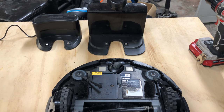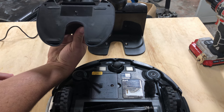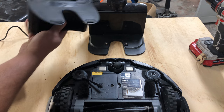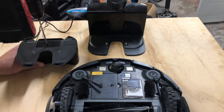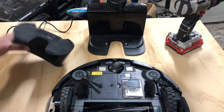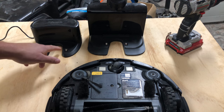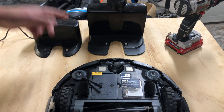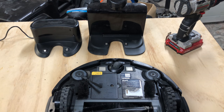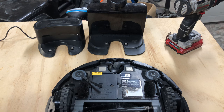How do we fix that? Get a new charger, or you can open up the charger — I believe it's going to be a T15 or T20. Open it up, you'll see the little springs. Find a spring that's similar to it, put it in there. Be careful — unplug it, it is live 110-120V, so be careful of that.